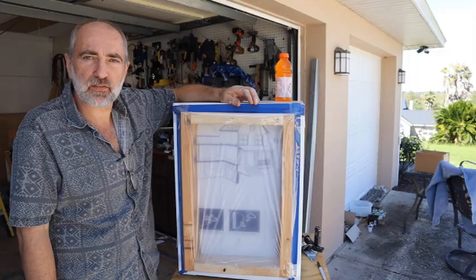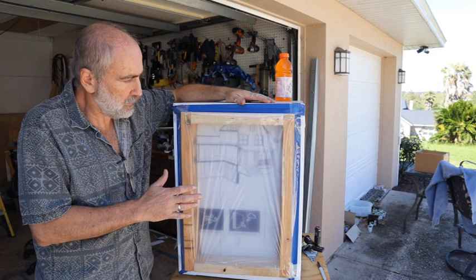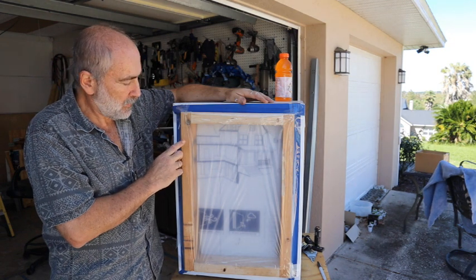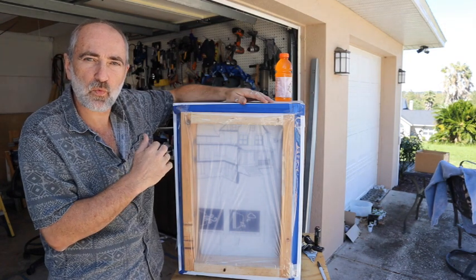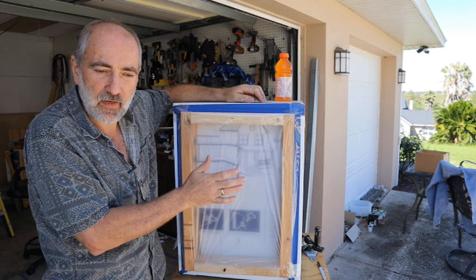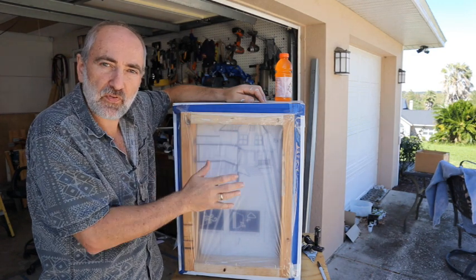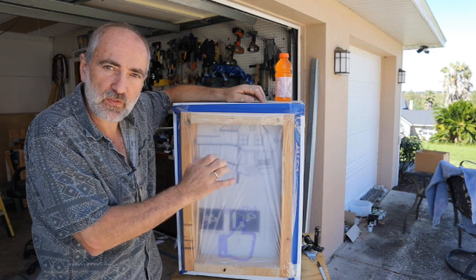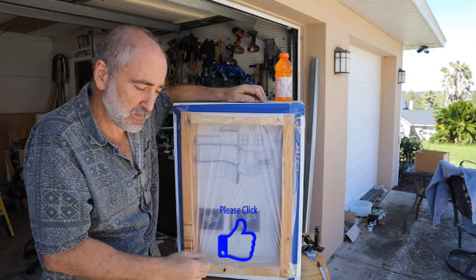Another 30 to 40 minutes has gone by and the refrigerator has been outside in the shade. I put in a plastic vapor barrier and sealed it in. Now I'm going to tear it apart and see where the condensation is. I don't think I would want a vapor barrier in my van because that means the moisture is going to be trapped against the wall. A lot of people use Reflectix and create a vapor barrier, but that's just going to trap the moisture in between, and it's got to be absorbed somewhere — and it'll be absorbed in the wood. That's a problem.